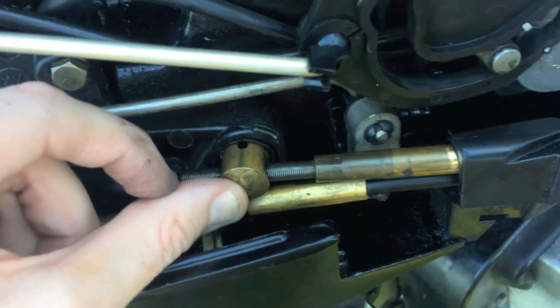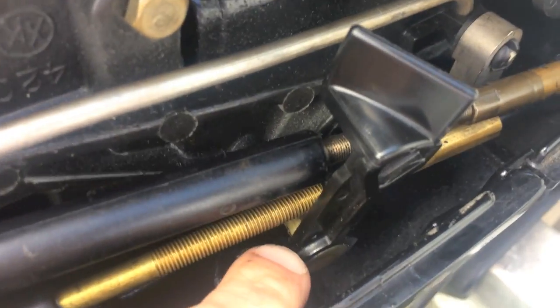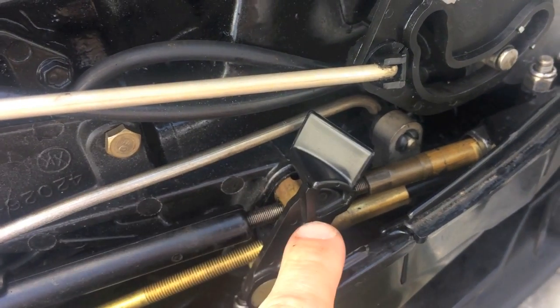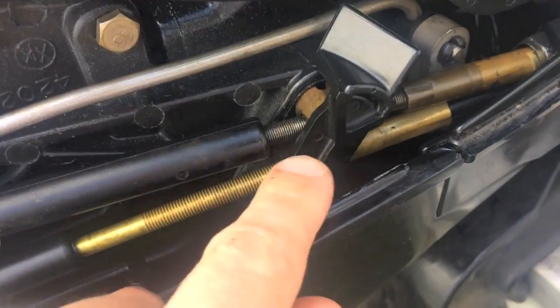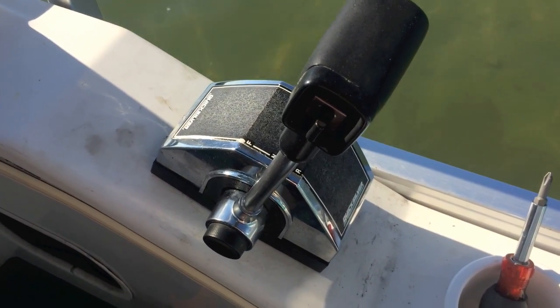This is where you actually adjust the shift cable. Right now we've got the shift cable and throttle cable back into position and we are going to wrap it with the rubber mount here. Put the secure mounting plate back on. Now grab that plastic tab that we took off earlier — again, be very careful, it is plastic and the hinge below is plastic — and you are going to shift this back into place. This is a very important part because when you put this tab back on, it doesn't allow the adjustments to change as the engine runs or come out of the housing.